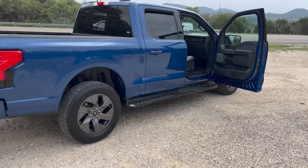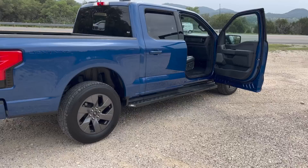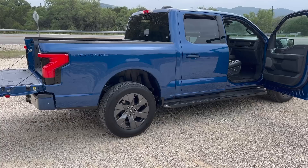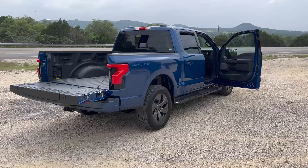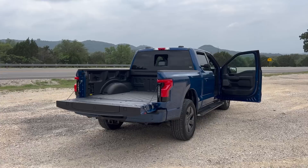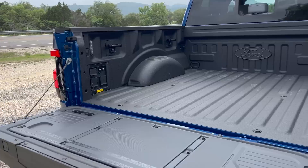This thing is sized correctly — a totally different battery pack and motor design from the Mustang Mach-E. We have two permanent magnet electric motors, no disconnect strategy here. I think that's probably okay with such a large battery pack. You'll have some flux-related losses with two permanent magnet motors because you can't torque-sleep them like an induction motor, but permanent magnet motors are great for big power at low speed.